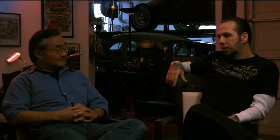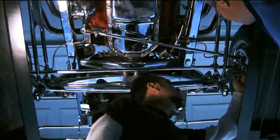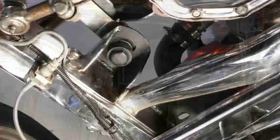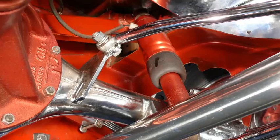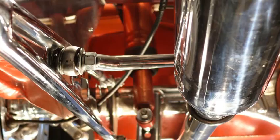This is a show car from the sixties, and here it is live and running and driving. I'm just amazed about how the front end looks — like these F100 brakes, how this spindle arm is all heated up and bent just so it clears everything, and the homemade wishbones. Then they went back and plated it all. All these welds look like TIG welds but they're not — they're oxyacetylene torch. Chris told me the builder was a union pipe fitter, so that guy could probably weld all day long. The car sits so low you really never see it, but he did it just because he wanted to. The front frame horns are big caps that are slid over and they're all chromed. There are tons of hours in it.